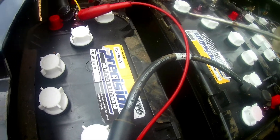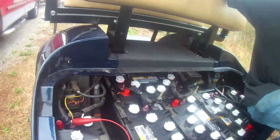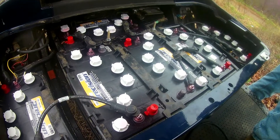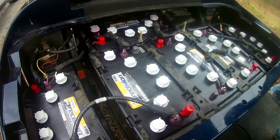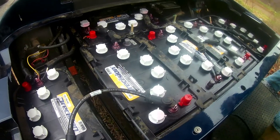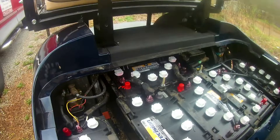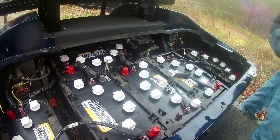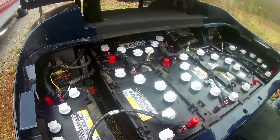Not the whole pack, because the whole pack can give you a false reading. When you're looking at pack voltage and you have a 72 volt golf cart, the rule of thumb is that closer to 80 volts is actually healthy — a super healthy battery pack. If you're around 72 volts after a full charge, that means it's only about three quarters of the way charged. Hopefully this video helps you understand a little more about battery dropout and how you can determine whether you have a battery issue or a charger issue. In this case, it was a battery issue due to each individual battery dropping two to three volts, which at the end of the day means you're losing 12 volts — a whole battery — and the more you go, the more batteries continue to drop out. Keep maintaining these batteries: water them every 30 days or so and keep them on charge. We appreciate you guys watching and y'all have a good one.